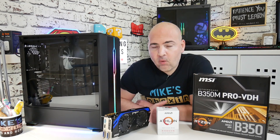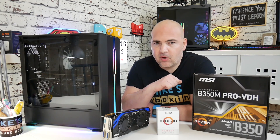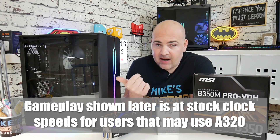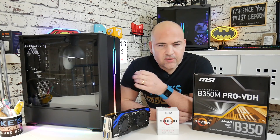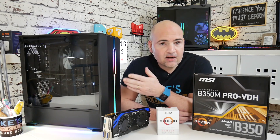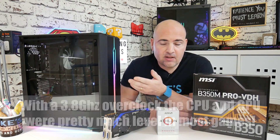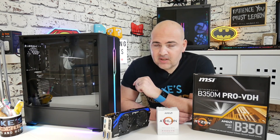So that's the components out of the way. Because this motherboard allows you to overclock the CPU slightly, I've done some game testing to see where the sweet spot is for the bottleneck of this APU with a graphics card. I've tried the 1050 Ti, the 660 Ti, the GTX 970, and RX 580. Out of all of them, the GTX 970 seems to be the best option. AMD drivers tend to have a slight overhead on the CPU, so the Nvidia drivers give this a little more of a fighting chance. In a lot of games, the CPU was pegged at 100%, but the graphics card was getting near 80 to 90%, and in some cases 100% — making this really the sweet spot.